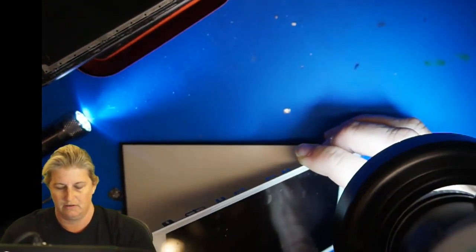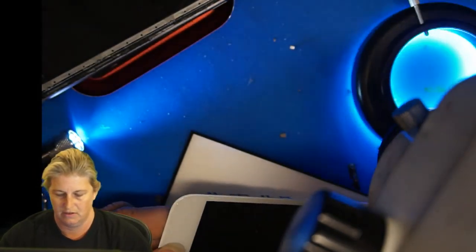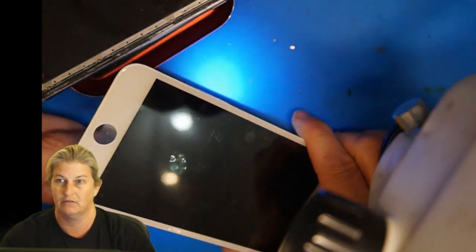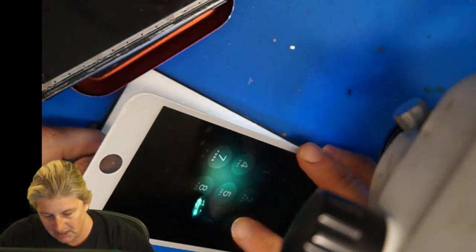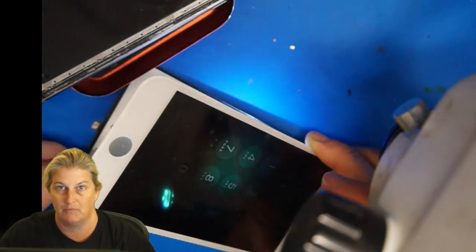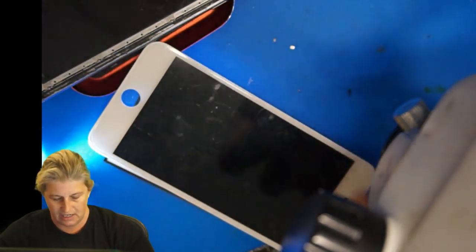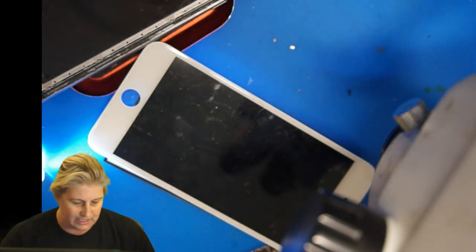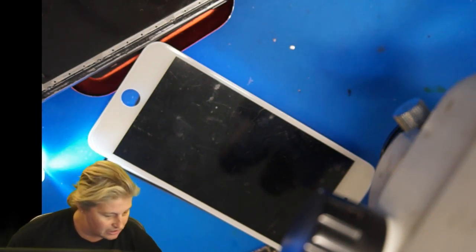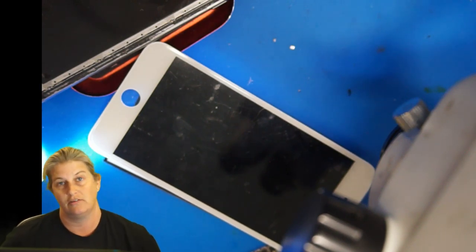It's way easier to show with the microscope light. Okay, so we're at the lock screen — we can even type in the passcode and we have a path to data. But if we connect it to the computer and plug it in, we hear nothing. Plug, unplug, plug, unplug — the computer doesn't detect this device. So we have a problem with the USB interface.